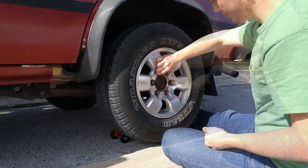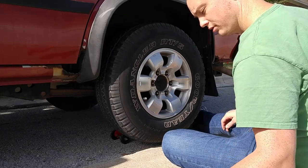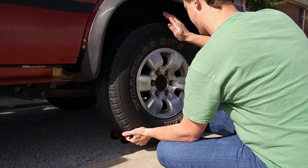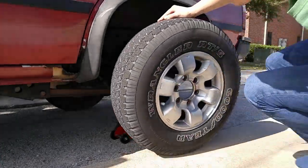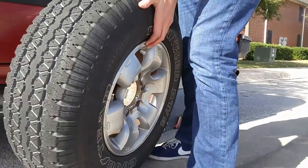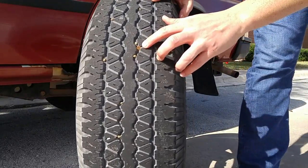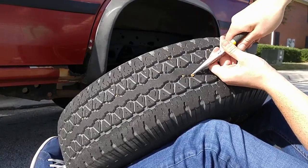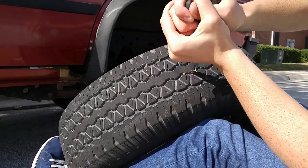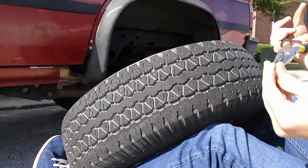After we've done that we can come back around and finish taking off the rest of those lug nuts. Once we've got all the lug nuts taken off we're going to take the tire off — if it's a little bit hard to undo just hit it a couple of times and it should come loose. After we've taken the tire off we can find where the nail is, and as you can see mine's the rusty little spot right here. It had been in there for about a week. Grab a pair of pliers — it might take a little coaxing to get out — and once it does come out it's going to let a whole rush of air out. The nail I pulled out was pretty substantial.